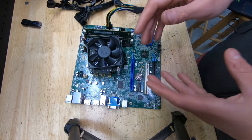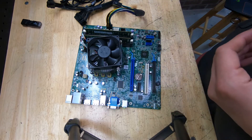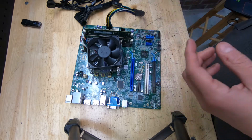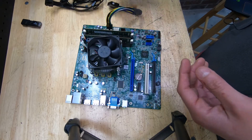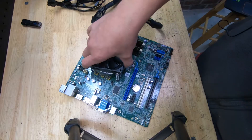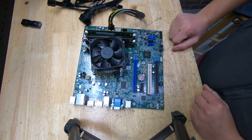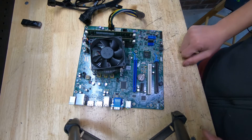If you're running a video card that requires PCI Express power, you can't use the original Dell power supply — you'll have to go aftermarket and buy one of these adapters, marry them together, and then you'll be able to use any video card you want. That covers the second adapter you need for the case swap.